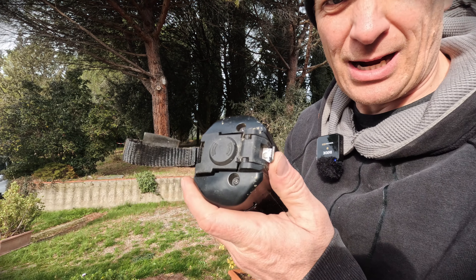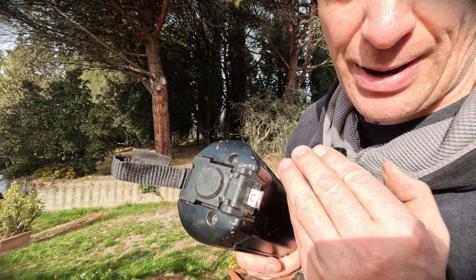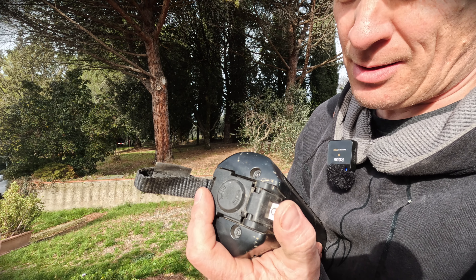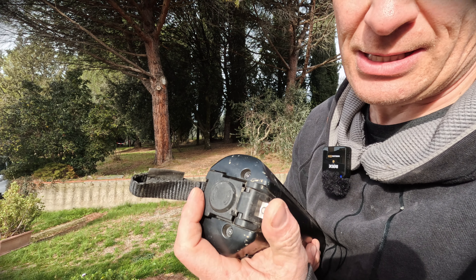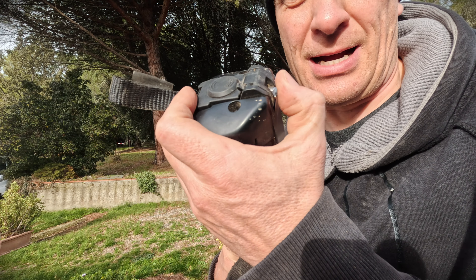So this is the problem. If we get close you can see: this clamp fits in the frame so the battery is snugged in the frame, and this fits against the locking mechanism. But as you can see, it vibrates — it moves — and that's not correct.